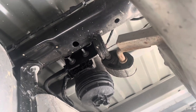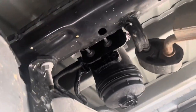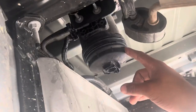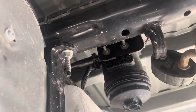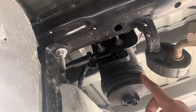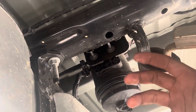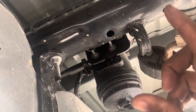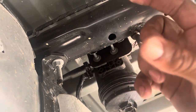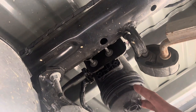I'm gonna give y'all a quick rundown — I didn't want to bore y'all with everything, plus I ain't got a camera so the quality will be trash. Basically you take this off, go towards the back of the truck and loosen it up. There's gonna be a filter in here — you gotta wiggle it out, it's gonna be kinda hard at first cause it's kinda stuck. Once you get that out, pop the new filter back in — remember how you put it in. The little piece goes to the top, and the wide open circle goes towards the nut. You'll see what I'm saying once you take it off.